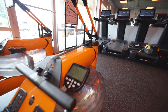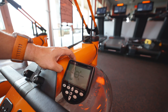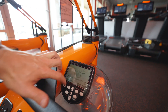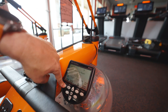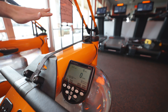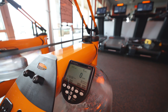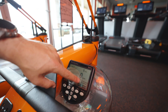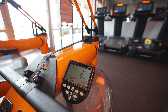One way you can tell if you have a sensor or sensor disc issue — take a look at this monitor. Take it out of OTF mode using up and down arrow, hit okay. Take a big pull, get the water spinning, hold down the power button, reset back to zero, then let go. That should stay at zero. If it stays at zero, it is reading properly — all systems are good. But if it starts reading meters or watts again while the water is still spinning, then that means you have a sensor disc, sensor wire, or actual sensor issue that needs to be looked at. That's the easiest way to tell.